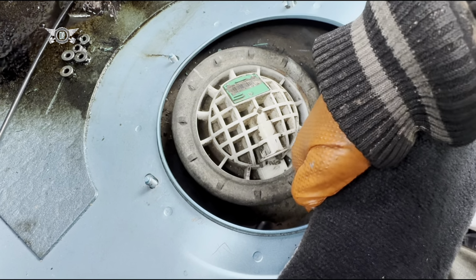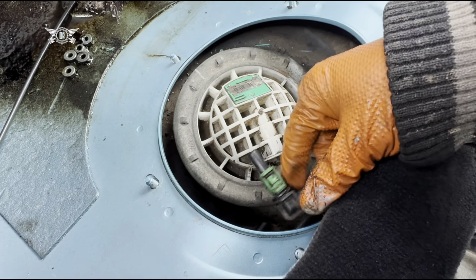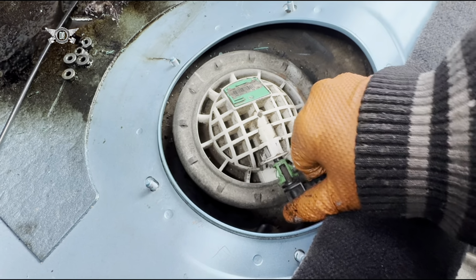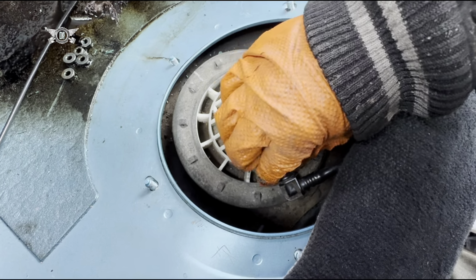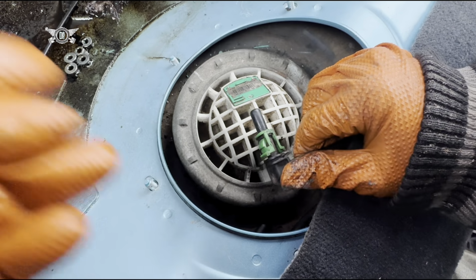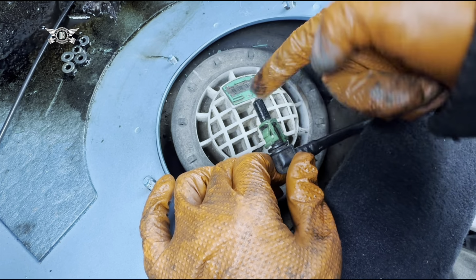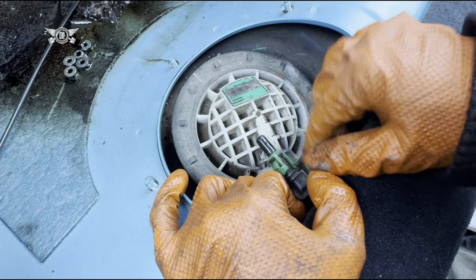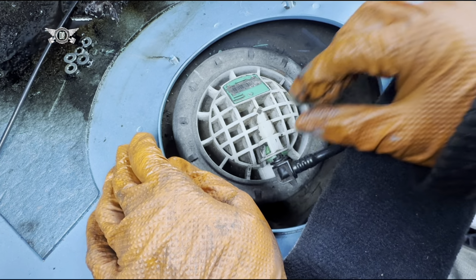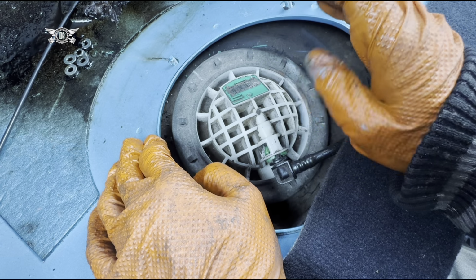So now my other hose is somewhere here. This hose just clips in. Actually, again, before putting this hose back in there, you could just put a little bit of grease on it, and that's going to make it go in a lot easier and without damaging the O-ring that's sitting in there. Very easy. Before I was struggling a little bit to push it in. Not sure if you noticed that, but as soon as you have a little bit of grease, it helps.